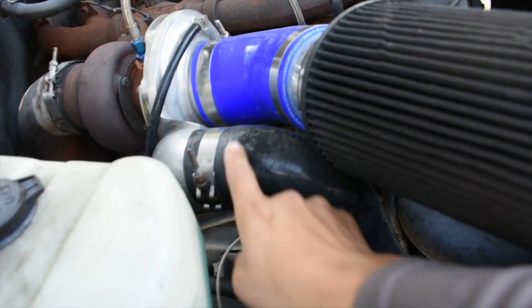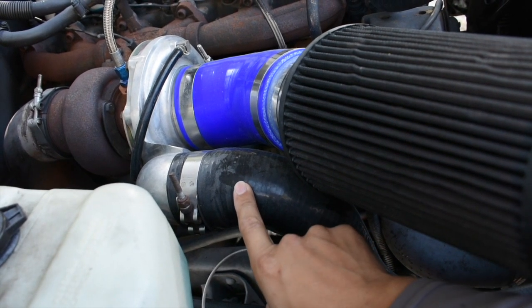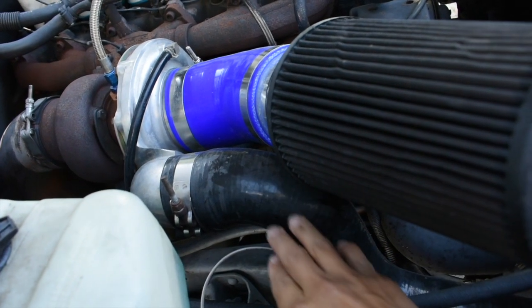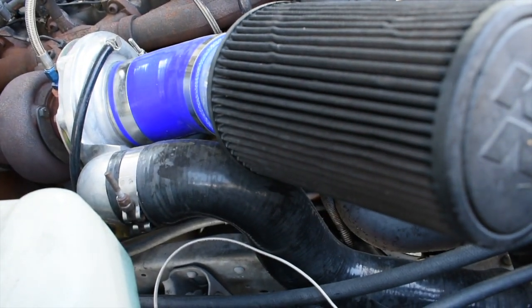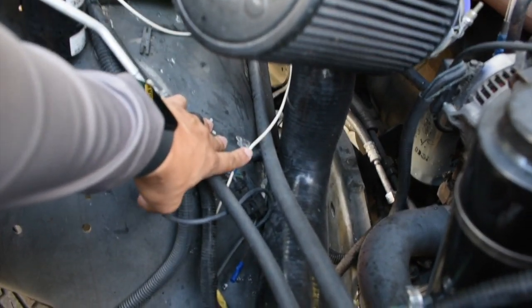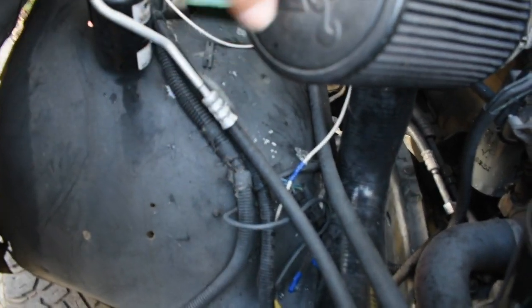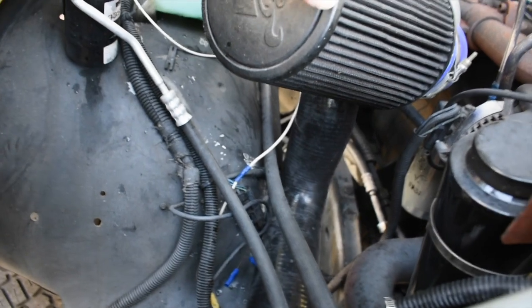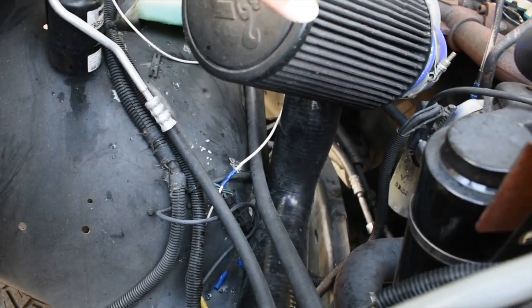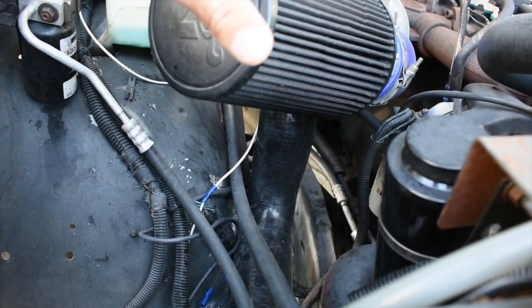As you can see, this is the tube that I got with DPS. It came with it, so we went ahead and installed it. But I don't like how it's installed in here for quite a while already, because it is rubbing on the fender, well, on this wheel well. And I don't like it. It's all bunched up into it, and I've been lately feeling like I've been losing boost, because whenever I step on it I can hear like a whoosh sound.